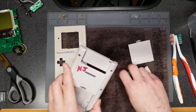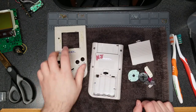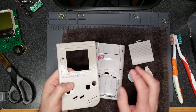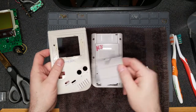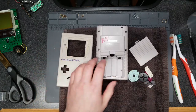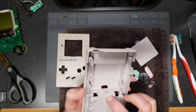The other thing is the nail polish initials 'NJ' that were painted on the back. Acetone will remove it, but acetone will also eat through the plastic — same thing with the super glue on the front. The bottom half of the shell is fine, and if I can get rid of those initials in the back, I can still use it in the future in case I buy a busted game with a cracked back shell but a good front.